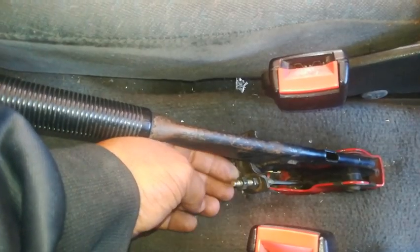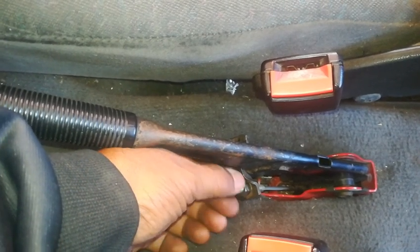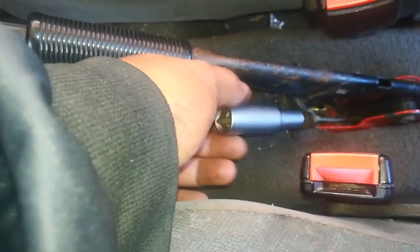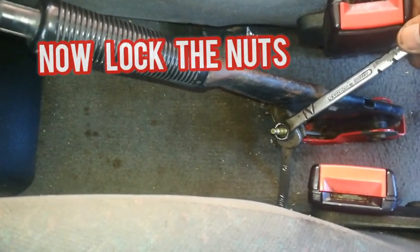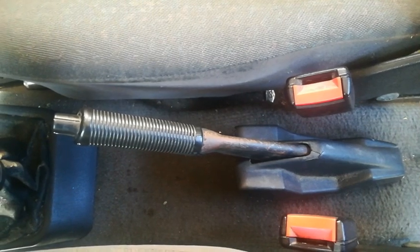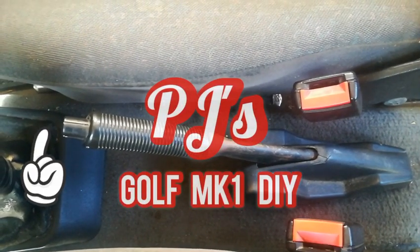Once you find that the rear wheel at the back is locking up nicely when you pull up the handbrake and it's nice and dead, then you can proceed to put on your second nut, which is your locking nut, to lock it at that setting. Then you can just lock the nut so that you don't lose the setting. So there you go guys — that is how you set your handbrake, how you make it feel a bit more responsive, and you can feel more confident when you park on hills and inclines. Generally your brakes will feel a little bit better. Thanks for watching guys.